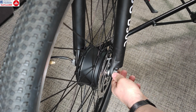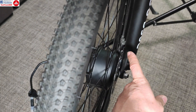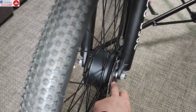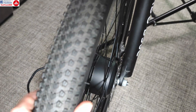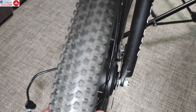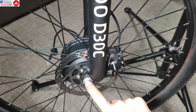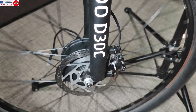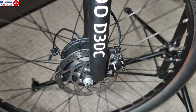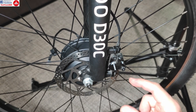The bike pushes onto the shaft and it has fitted the front fork. Now we are going to tighten up the nuts by hand and check if the disc brake touches the fork — it doesn't. We also look at the screws that hold it and they get millimetrically close to this part but they don't rub or touch, so it's all okay. The caliper has fitted in the space but will need some adjustment on the bracket. Tighten up and secure the screws, secure the caliper, adjust it, and final test — it spins freely with nothing touching and no weird noise.